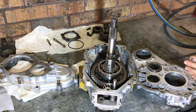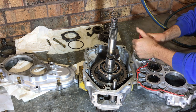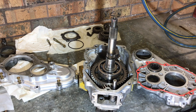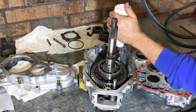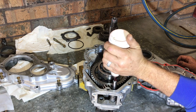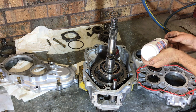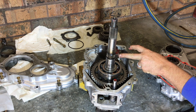So the reduction box is all good. The next step is to put the back on the reduction box — that's the front of the four-wheel drive, two-wheel drive case. Step one, we're just going to use some plain sealant, no gasket. Now we're going to use some assembly lube on all the bearing surfaces. It's halfway between a grease and an oil — sticks, but then it just dissolves in the gear when you get it all together. The feature on these Marlin gears is it's got oiler holes for the roller bearing.